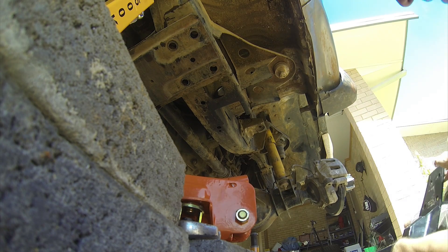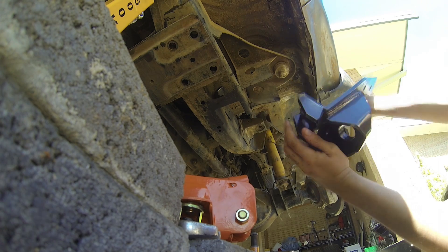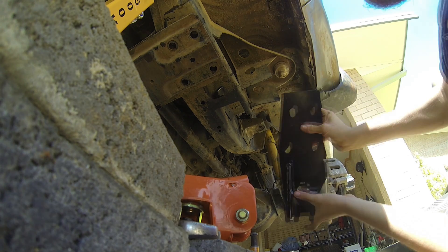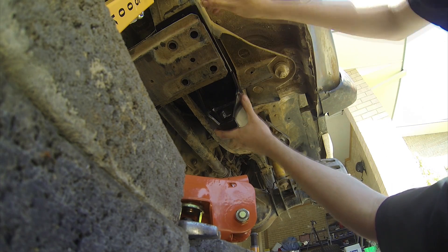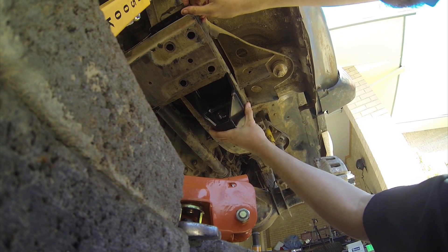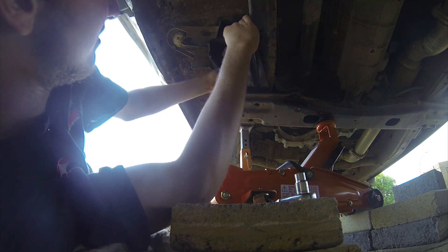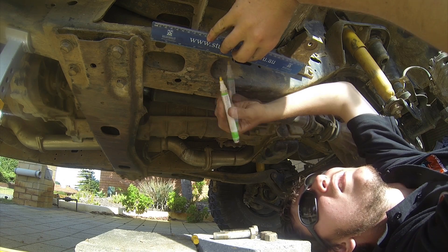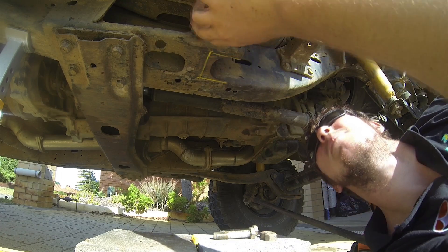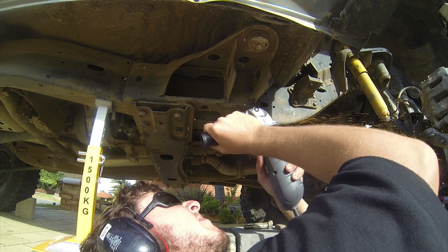You should just be able to slide the drop box straight on in like this. Seat it in as far back as it'll go. Push the bush in from behind until it fits where the old control arm end was. For some types of drop boxes, you'll need to mark and cut out a square on your chassis so the drop box sits all the way back.